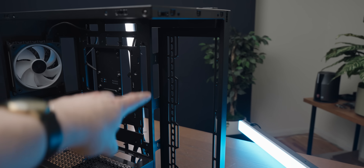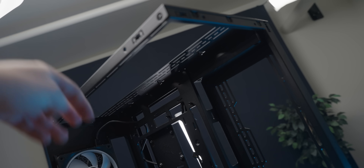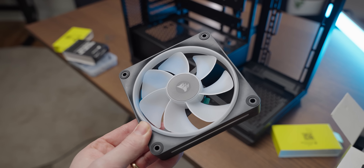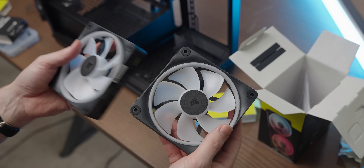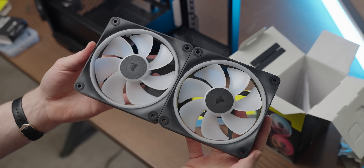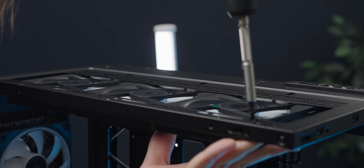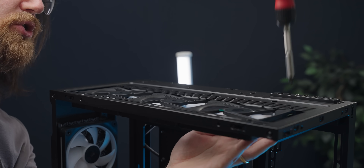Because I want to mount the radiator on the side, I'm going to mount some more fans in the top, and I want these fans to be intake. So I'm going to use these LX120 reverse fans, which have the opposite airflow direction to a normal fan. The fan blades are oriented the other way around so you can use them as intakes but still have this side of the fan showing in the case. Another thing that helps make these fans easy to work with is their iCUE link — you can just snap them into each other, and then use fewer screws to mount them.